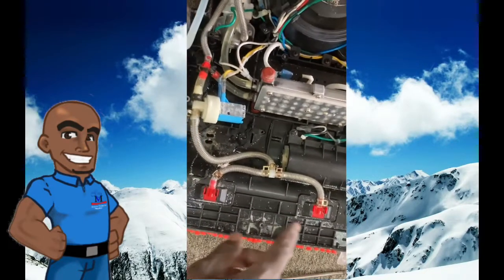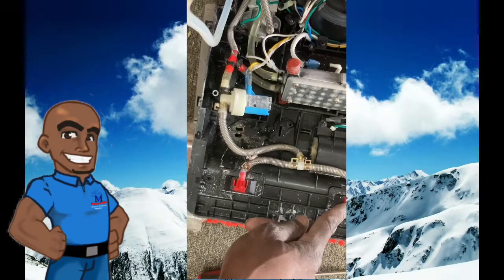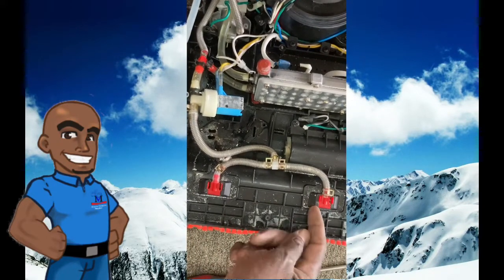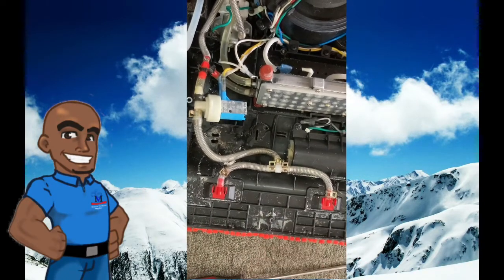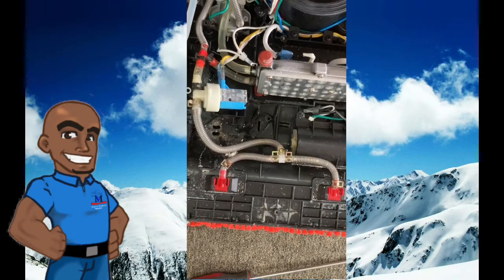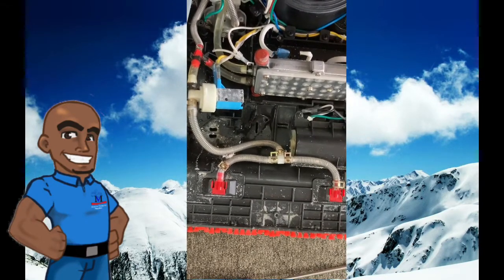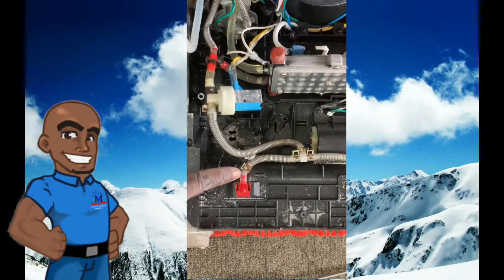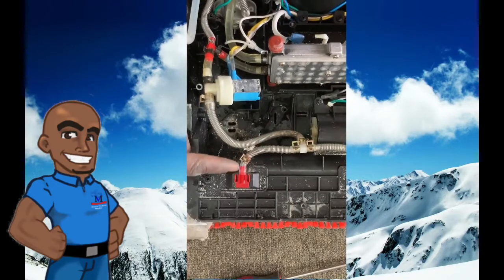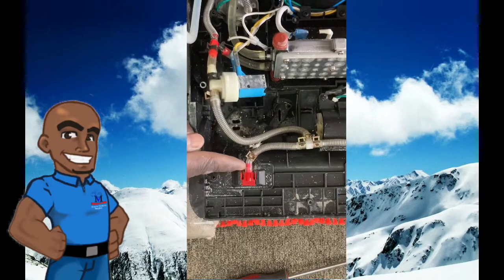Remove your jets — that's probably the first thing you should do before you start opening the machine. And I would even go ahead and use a very small drill bit and open that hole just a little bit wider if you're having a lot of problems with clogging with this jet, because it's very small. The idea is to allow the water to jet out by restricting the passage for the water, so the force will just make it spray. If you're being plagued with cloggage, it's probably best to do that. Needle-nose pliers can squeeze this and you can remove this clamp, and then pull your tubing out. If you can't just yank it, use a flathead screwdriver and pry it out.